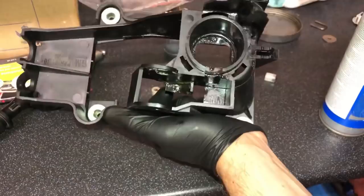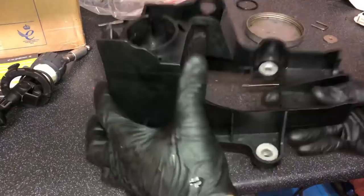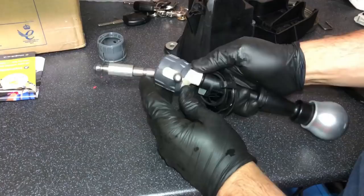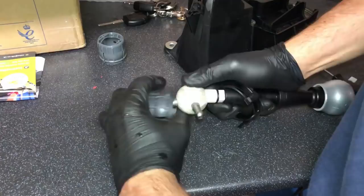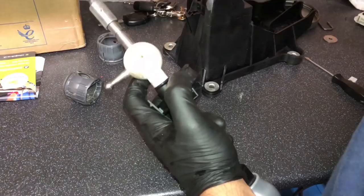An O-ring that often gets overlooked is the one at the bottom that sits at the bottom of the casing — make sure you replace that one as well. So that's the unit fully cleaned out — looks brand new again. We're going to start assembly: start with your O-ring, put that down in the bottom of the casing. Remove your bush back off the ball joint, and then there's another O-ring up here which you need to replace — swap that one out. You've got another new one in the kit.